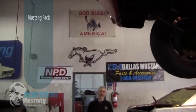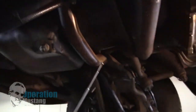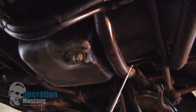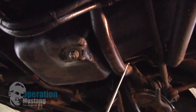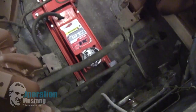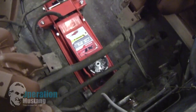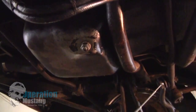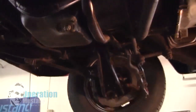I get a lot of people asking how to jack up an old car or old Mustang. You've got to be really careful where you jack them up — you don't want to put the jack underneath the wrong spot and put it right through a floor pan on these unibody cars. Underneath the front of a Mustang, just behind the lip of the oil pan, there's a cross member bolted to the thing — it's pretty rigid. Slide the jack underneath the pan, put it right on that round bar, and jack it up slowly until the two front wheels are off the ground, then set jack stands under it.